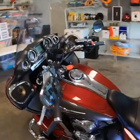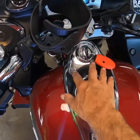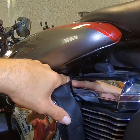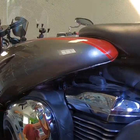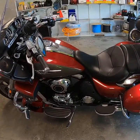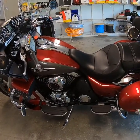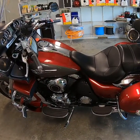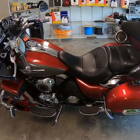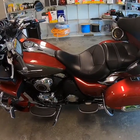Removing the fuel tank is not really difficult, but there are several things you'll need to know. We have to remove the collar around the ignition, remove two bolts, and this piece will lift up. We'll need to remove the seat, unhook the wiring harness, disconnect the fuel line, and on the other side there's a vent tube. When you remove the vent tube and fuel line you'll lose a little bit of fuel, so have a couple rags handy. Once the fuel line is off it usually stops dripping, so you won't make a giant mess. It doesn't hurt to run the tank down a little bit before you take this off.